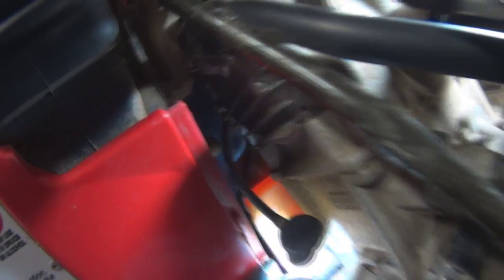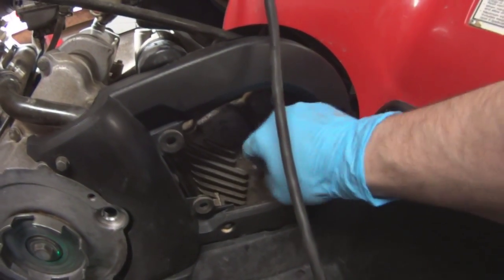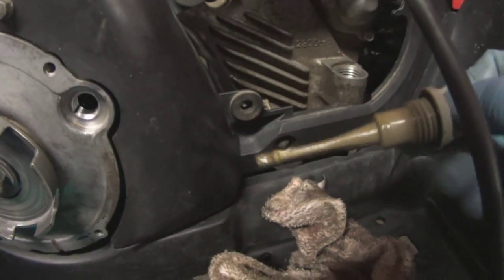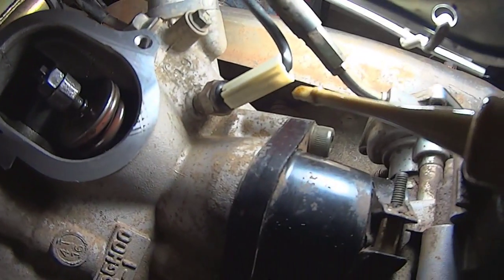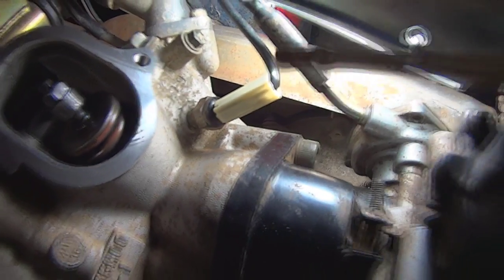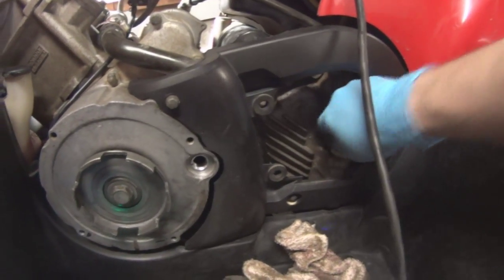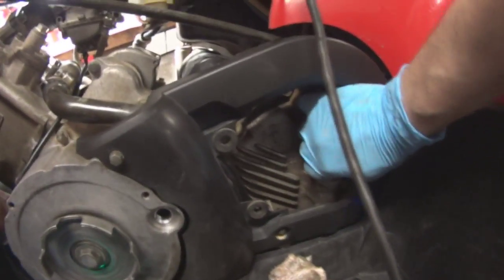Of course, I'll check all the fluids before I assemble everything. I think the fluids are all fine — the coolant is fine, you can see it through the tank. I changed the oil when I bought this quad 70 miles ago. The tip should be dipped in oil, and that's exactly what you have — it's nice golden oil. It's Mobil 1 — I only use Mobil 1. So oil level is good.